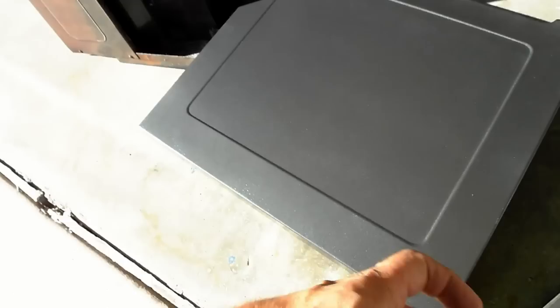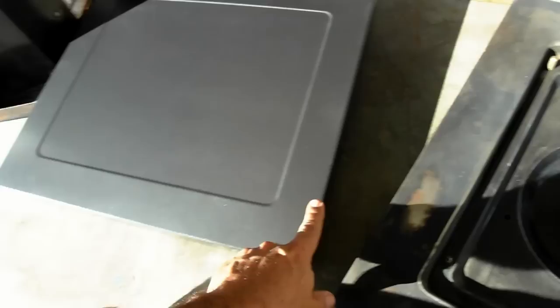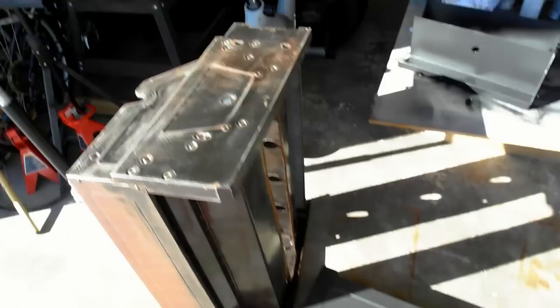I also found when I'm spraying, you don't want to just go squirt, squirt. You want to do full sprays. If you try to cheat it, I got a couple drips coming out of the bottle. So you do want to be more deliberate, start before you touch the side and just go full strokes back and forth across it. So that's what I'm going to do. Right now I'm going to hit up this guy and go ahead and do this guy as well.